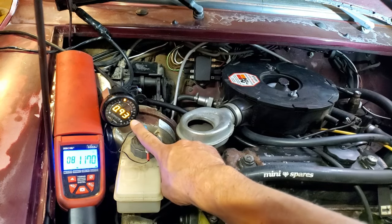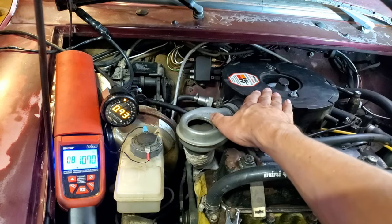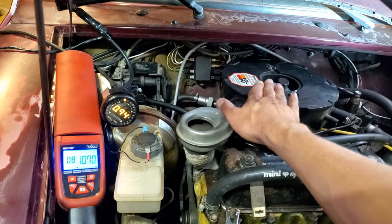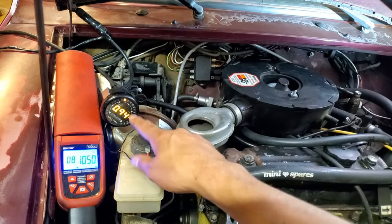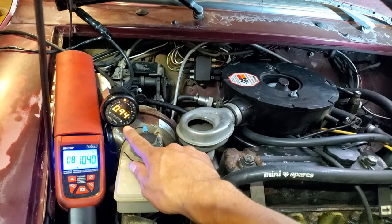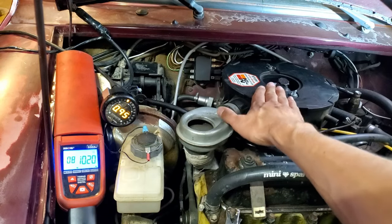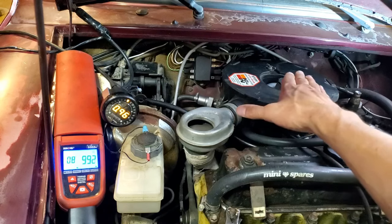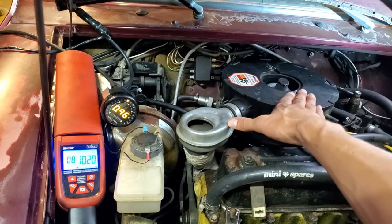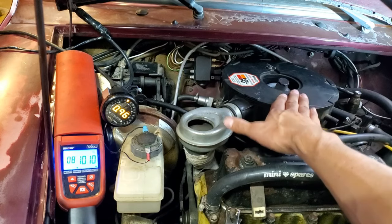As we saw, it wasn't going into the 0.8s anymore — it was staying in the 0.95 range. That just goes to show you that these air filter housings can be restrictive at the upper end, even with a good filter inside. This is why you need to check what your airflow and fueling are doing at high RPM with the cover off and then test separately. I think this engine is running fairly smoothly and responding very well to tuning.